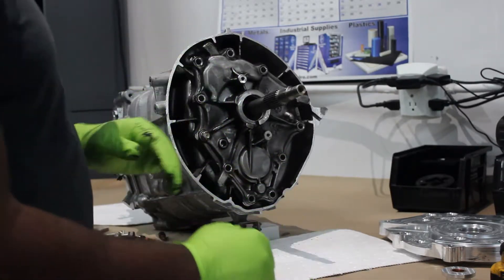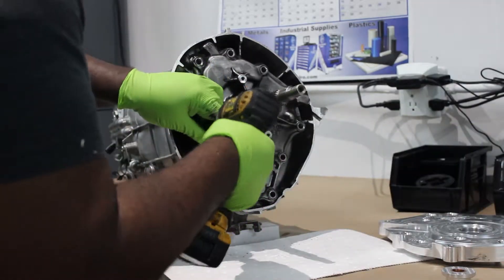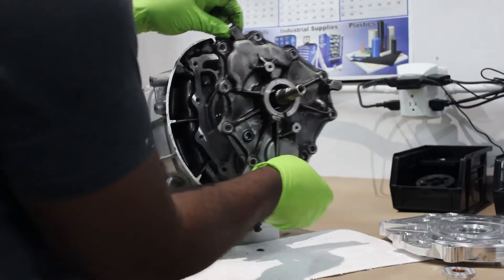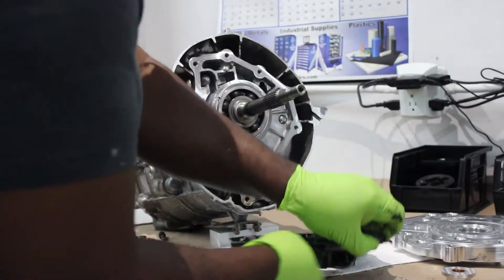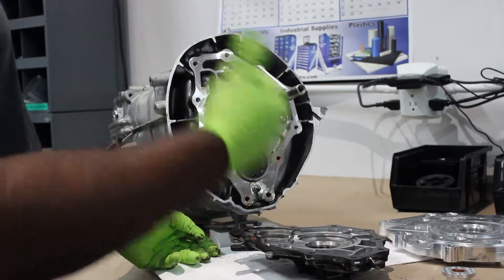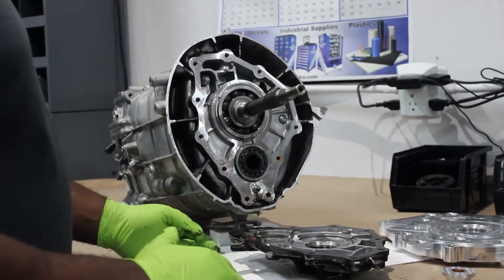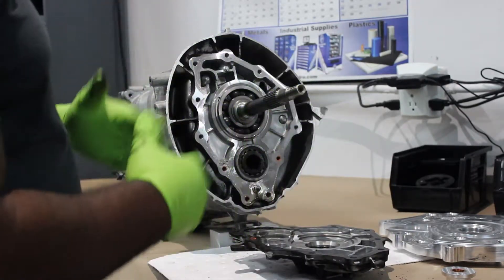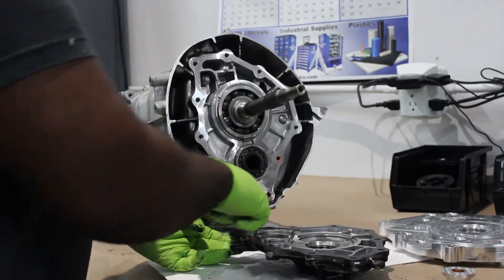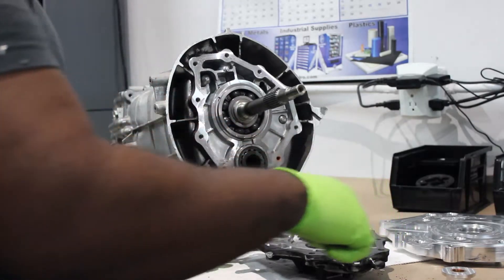You really don't need the Loctite back on the lower bolts. The plate will pop off. As you can see, the gasket is here. Some of you guys will see other videos where guys don't use a gasket — they just silicone it. That's not what I do. I reuse the gasket and apply a thin layer of Permatex going all the way around.